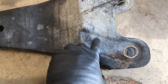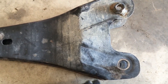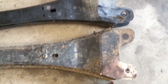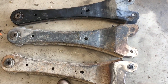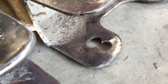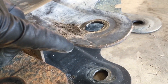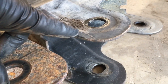When I saw this stamping I wanted to reinforce it, and I thought that was a little bit more difficult. I talked to a guy through Facebook who had made a modification to these and found that the older ones — here's an older one, I think it came off an 07 truck, but 05 to 07 is what these came off of. If you look at this one it's flat, and these are slightly heavier stamping — I'm talking like a hundred thousandths difference — but they are in fact heavier.